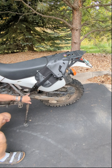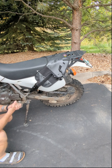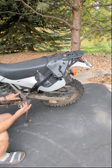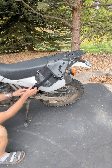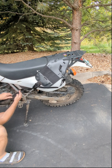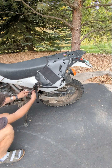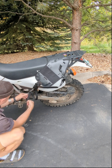This one's all set up because it had passenger pegs and so on with the XR650L. Let's say you have a KTM EXC series, a Husky — I think it's the FE — and a Gas Gas of the equivalent design. You're going to have that subframe come up to here, like on a Honda CRF450L. You're going to want to wrap that around that junction so you get some downward force around the junction and then back through the buckle. Very simple. Let me just rethread this and I'll explain how to do the rear.